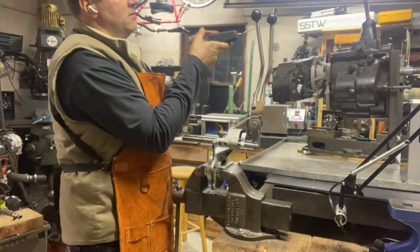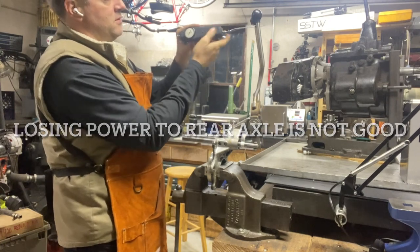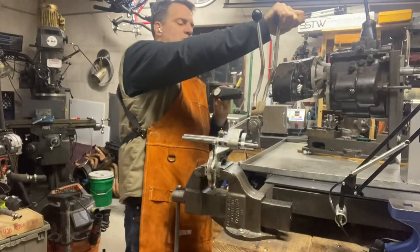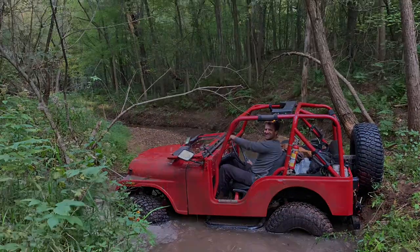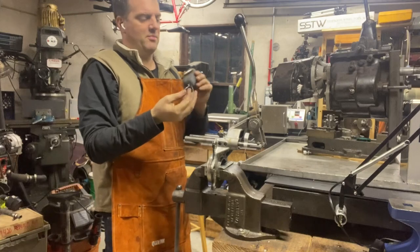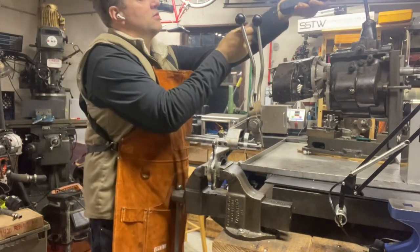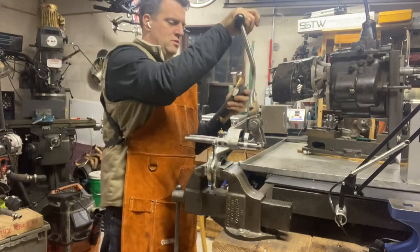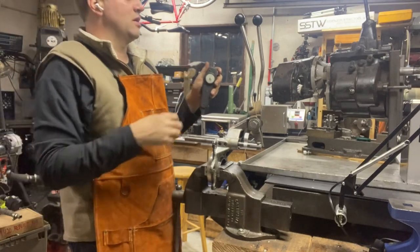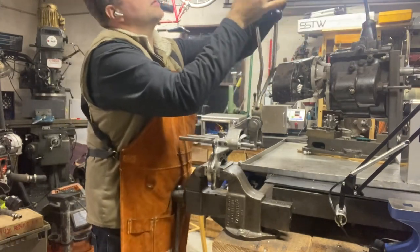That's the issue with the transfer case — it can pop out. It takes five pounds of force to come out, and up here is low range. What I notice is the rear axle can pop out of low range with just five pounds. High range is even less. For whatever reason, I'm getting three pounds on the rear axle coming out of low range.